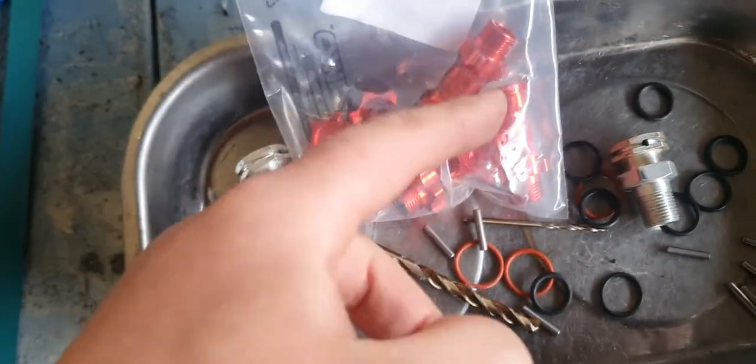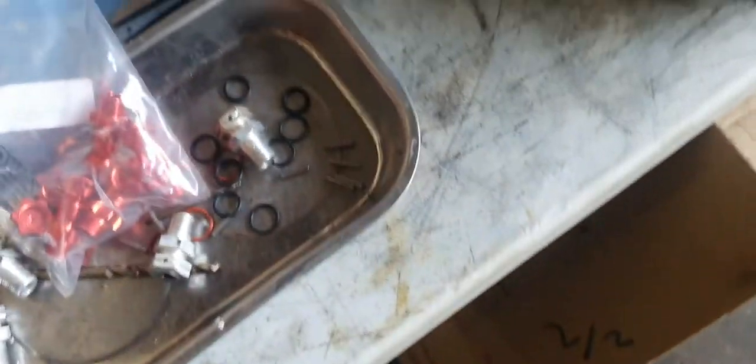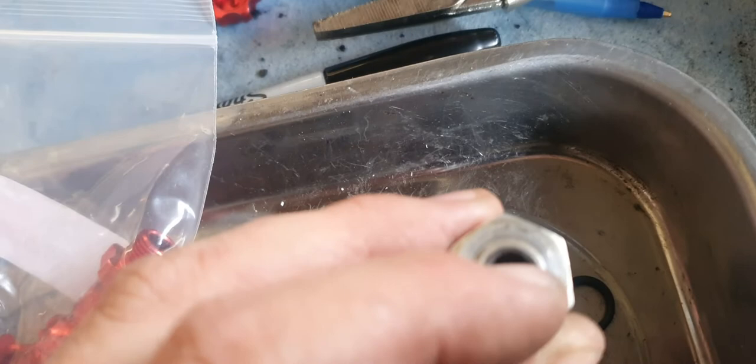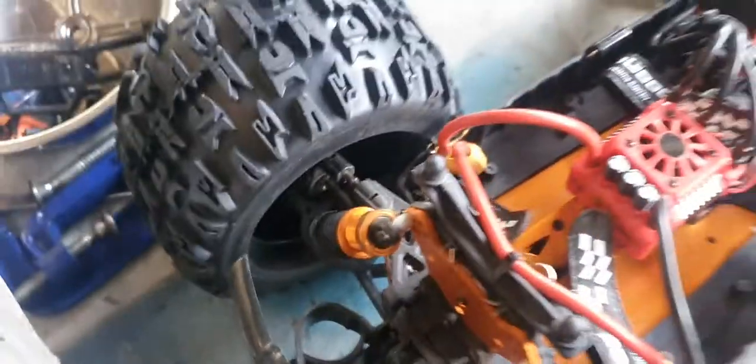These are longer, so when you put them on, the wheels are out a bit more. I had 3D-printed bushes — I was going to make them out of aluminium on the lathe, but it only takes eight minutes to 3D print them so I just made them out of plastic. The bore was bigger: a 6mm bore with an 8mm OD bush that was 15mm long.